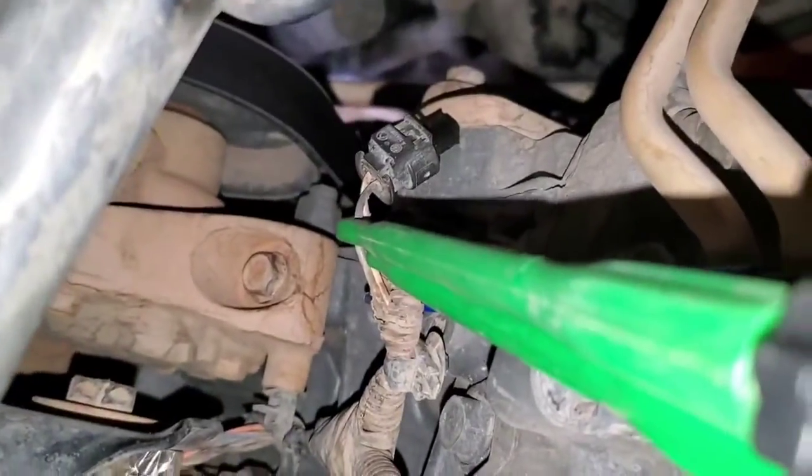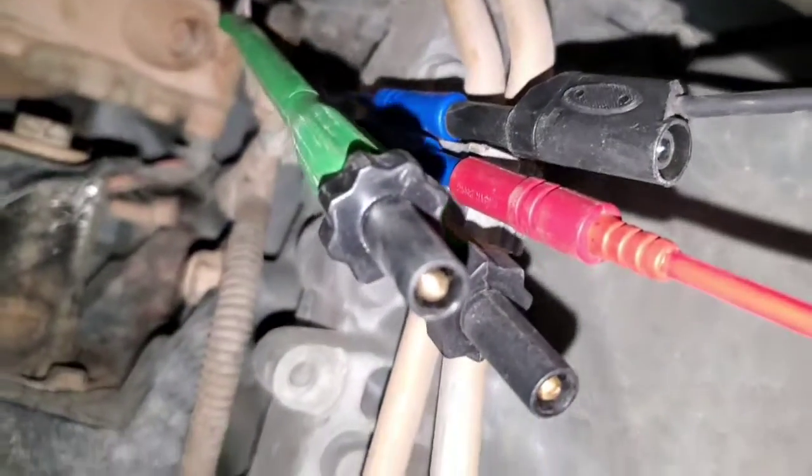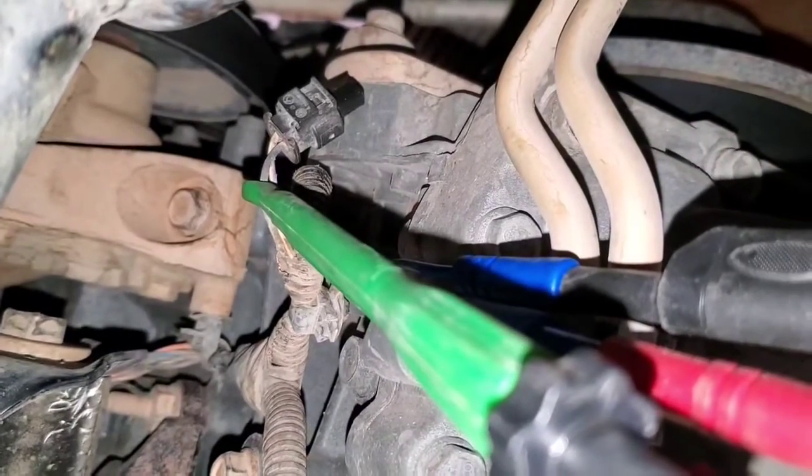You come over here — it's that connector there. You can toggle the voltage to it, and when it was unplugged it was getting a solid 12 volts, reading both the ground and power on it. But then when you plug it onto the oil pump, it would only give about one to four volts, just going up and down like crazy.